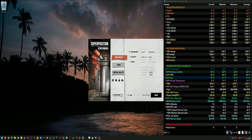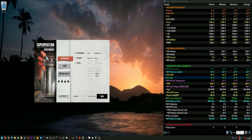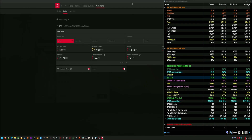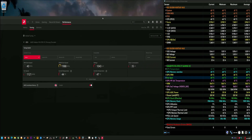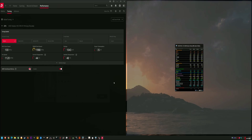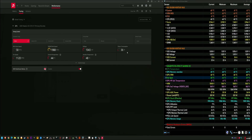I am running a slight undervolt because Radeon drivers were crashing at stock — it actually overclocks my card beyond the advertised overclock. This card is meant to have an overclock around 2,640 MHz or so, but it defaults to like 2,680–2,689 MHz on stock settings. What that does is crash the card as the driver loads into Windows, because even if you set an undervolt in a performance profile, before that profile can load, the driver loads in with stock settings which is unstable. And as soon as the driver crashes, it will prevent any tuning profile from loading at all. So I went through MorePowerTool and custom set everything.